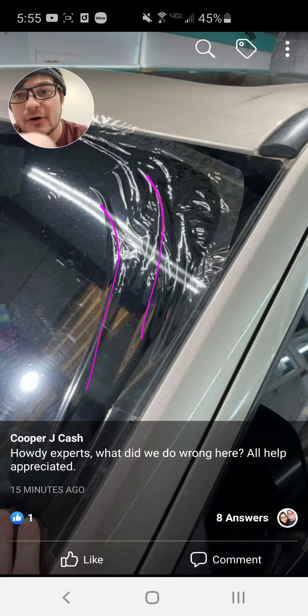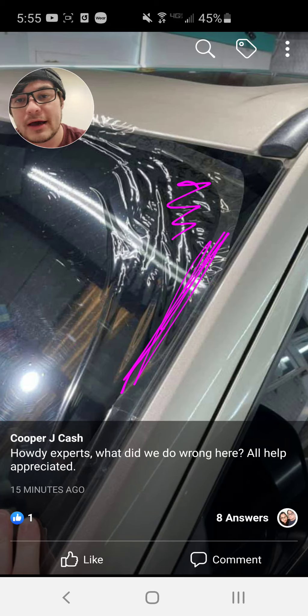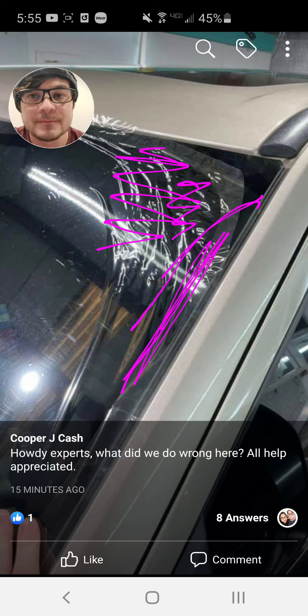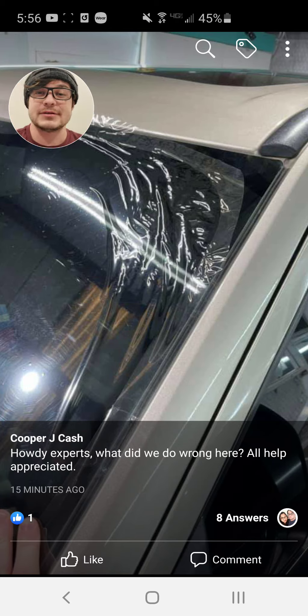What you want to do is not lock down the side so hard with an H-pattern. You don't necessarily need to lock this down super hard — you can push some of it out and just sweep it out. Most of your shrinking for some of these top corners, to alleviate what happened here, would be to kind of move a little out this way and then focus more in an even space here.